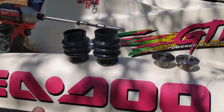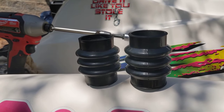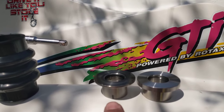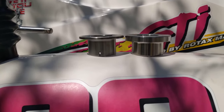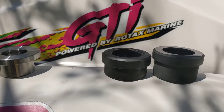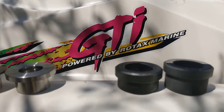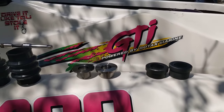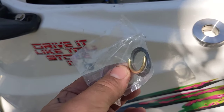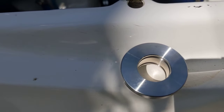Side-by-side comparison of the old parts and the new parts — the old parts are on the left. That's the older bellows; you can see the new one is just a little bit taller, which means it'll press tighter, but it's also going to be a little harder to put on. Then this is the old slip ring and the new one — you can tell it's much thicker, at least twice as thick, and also heavier. The carbon rings: the only difference is the new one has a longer shank, but that goes inside the boot. All in all, they look like heavier-duty and bigger parts.